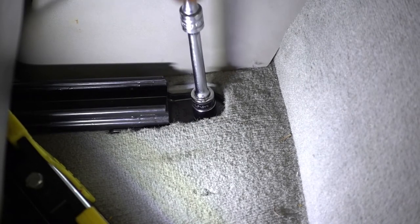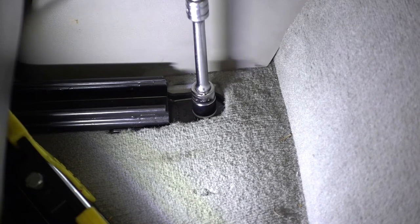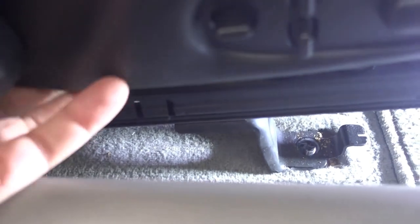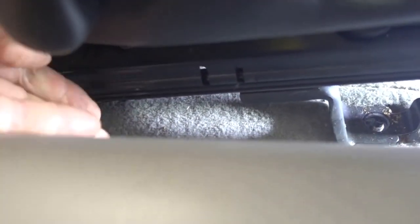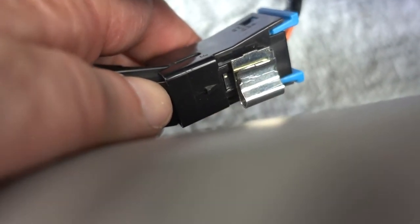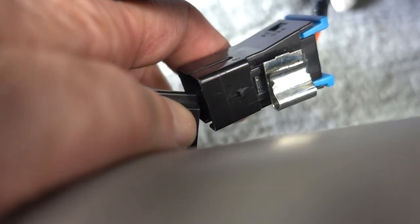On to the rear bolts. It's always good to have a third hand. On the underside of the seat, on the right side of the passenger seat, you'll see an electrical connector that has to be unhooked. The connector has a metal clip that holds it to the underside of the seat rail, and there's a plastic tab on the opposite side of the metal clip. Push that to release.